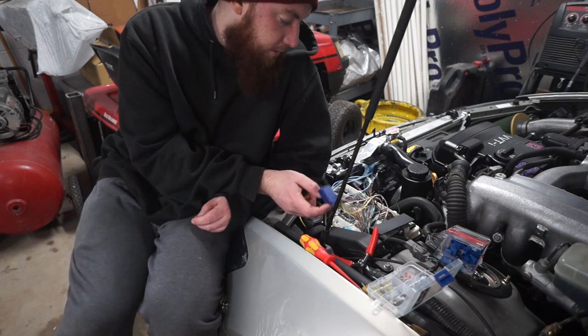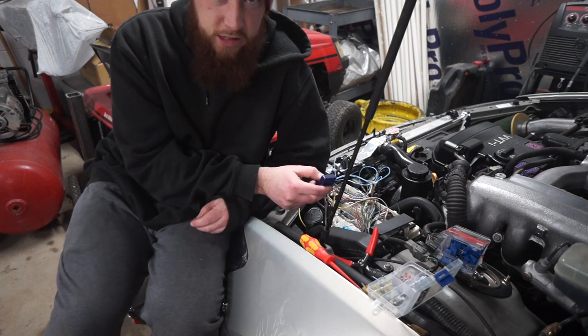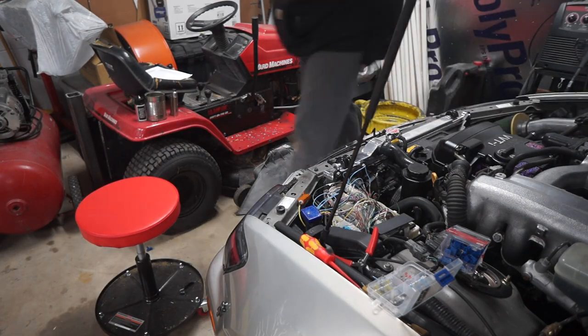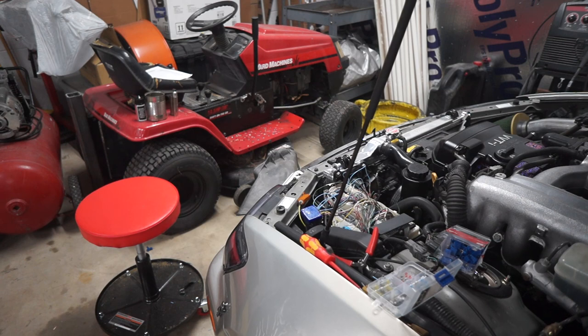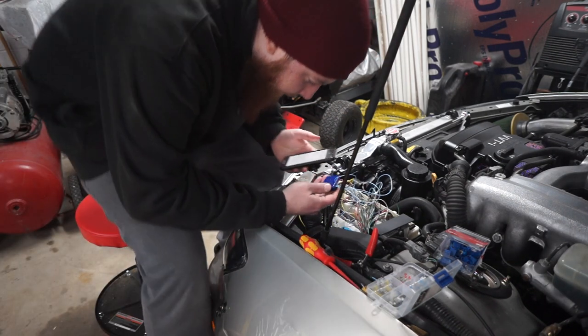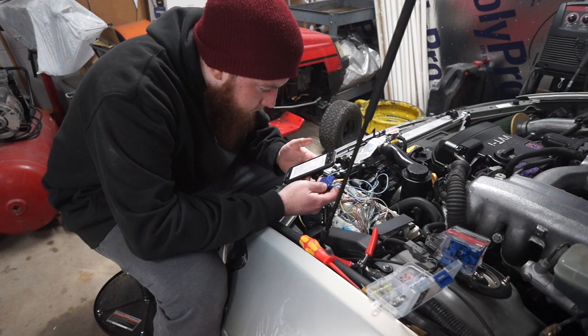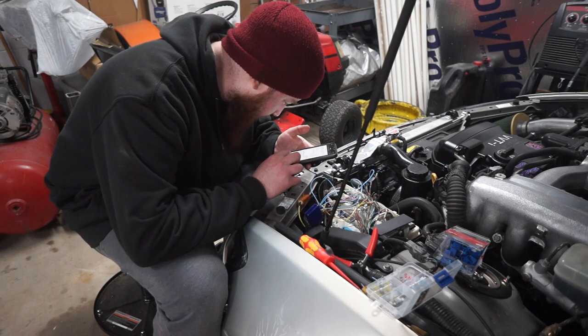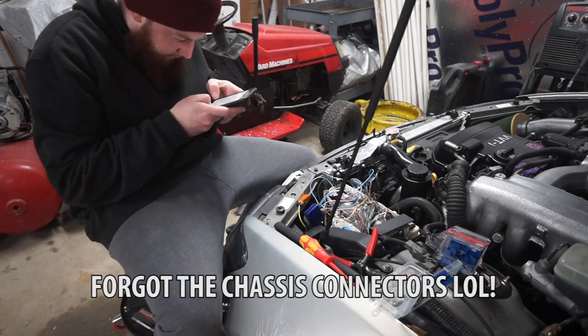Because if it doesn't start, I gotta troubleshoot it. If it does start, I'm gonna wire in the resistors and fix the speedometer. So let's go from there. Okay, this thing's lighting up, which is good. It's supposed to. But it's not cranking, and I think that's because of the park position sensor, so...